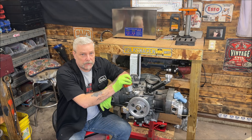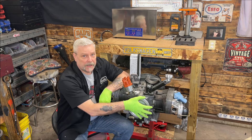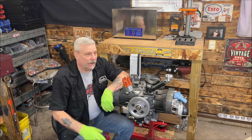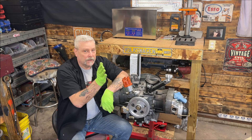Obviously I removed the distributor cap. One more critical thing: when your distributor is removed from your engine, do not turn that crankshaft. Do not rotate the motor. You'll chew the gear up in the drive gear and then you're going to be pulling everything apart. If you turned it like an inch, don't freak out — you'd have to start cranking it around for that to happen. So: distributor out, no turning gears.